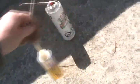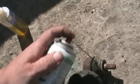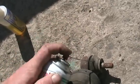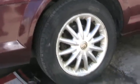That's supposedly bad news, but if it's squeaking that means it's already getting water in there. Remove your little tool — you have a choice: squirt oil in there, or stick this little nozzle in there and squirt chain lube like so. Fill it all up, and if you wait a few minutes it percolates all around inside there and your vehicle is fixed.